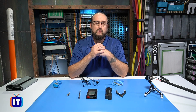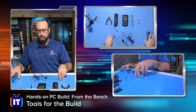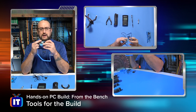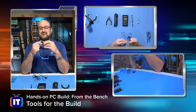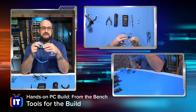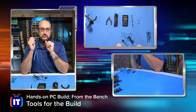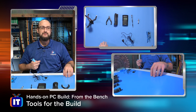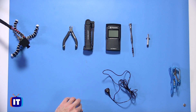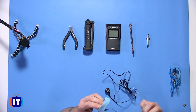Let's go ahead and start out with probably one of the most important things we have on the bench right now. This is what's known as an anti-static wrist strap — wristband, you might have heard it called a geek strap before. What this is used for primarily is to take any static charge that's in your body and dissipate it away — into one of two things depending on how you're using it. You could be using it like we are. This big blue mat that you see here is actually an anti-static mat. It's not just here for deco — it is electrically resistive, and it's going to help keep that static charge from entering any of our components.